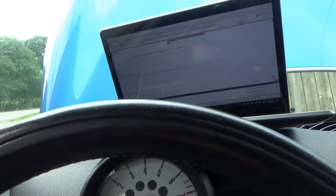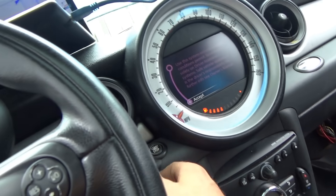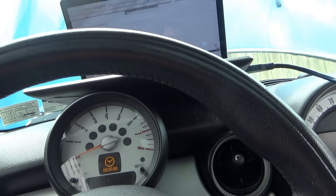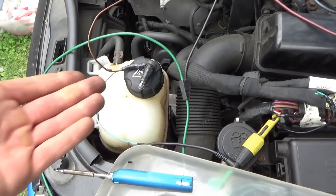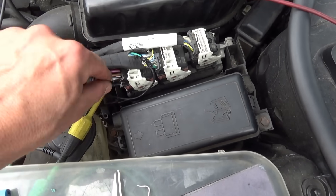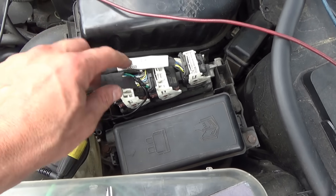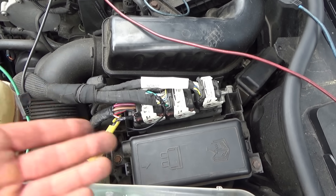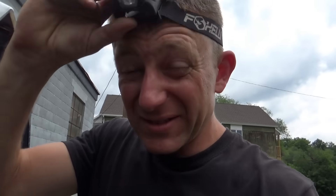Alright, we have power to the ignition coils. Ignition key — fire it up. Sweet. We'll power it down and make sure it's happy. We want to see those voltages go to zero when the DME relay shuts off. Light bulb turned off — there's our bypass. I want to put a little label on here saying 'ignition coil positive feed' so people in the future will know what's going on. MINI is fixed, no parts required. To fix it the right way it's probably going to total this car. Appreciate everyone watching — see you in the next one.